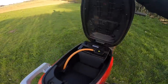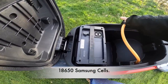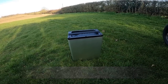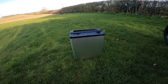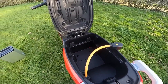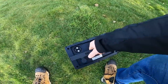The battery is 72 volts — I've worked out it's approximately 2.88 kilowatt hours. It's a big unit but removable. Straight out and out it comes. It's not the smallest battery in the world, but the energy density is good — on their previous bikes you'd normally need two batteries bigger than this to get the same range and power. You could also have a second battery and swap them over to suit your lifestyle.